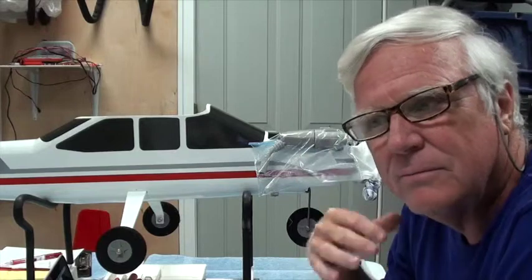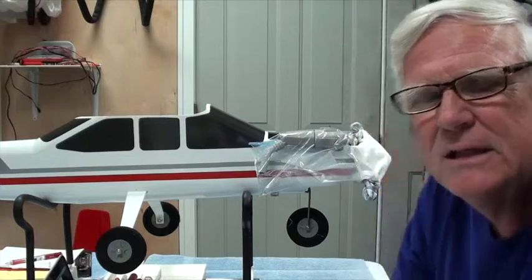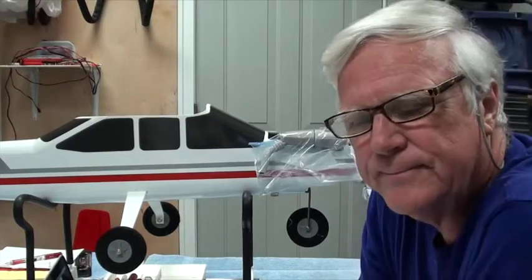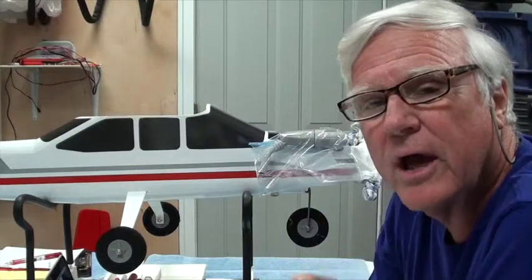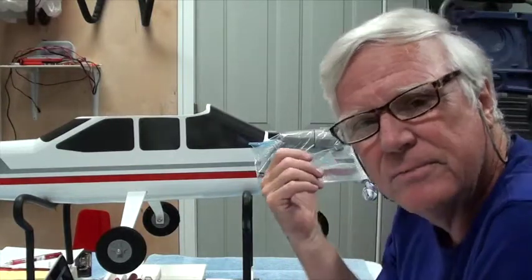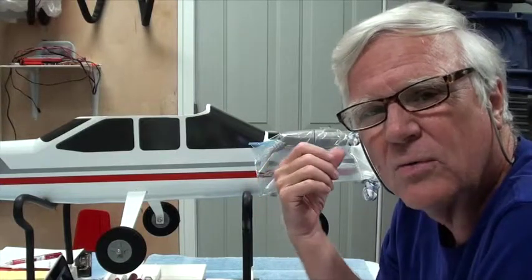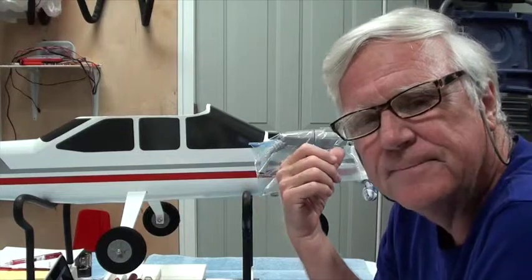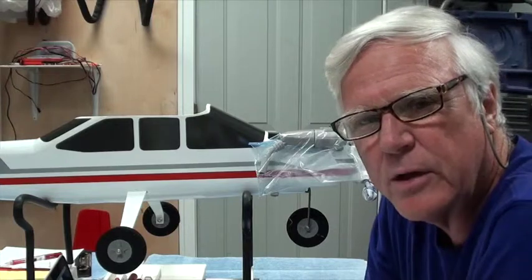To me, an engine break-in is at least 5 hours on the engine, and this one's had, well, let's see, 4, 5, 10-minute flights now. So it's had less than an hour. So I did do 2 clicks leaner today. Still sounded okay. And I'll show you in subsequent videos how I test for whether that's a good mixture on the needle valve. So that'll be a subsequent video as well.